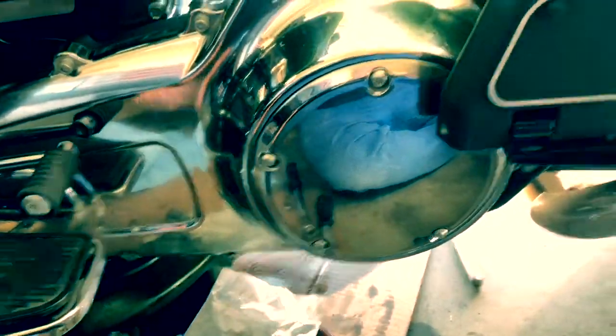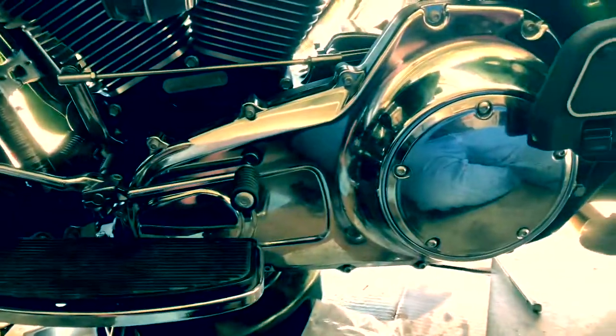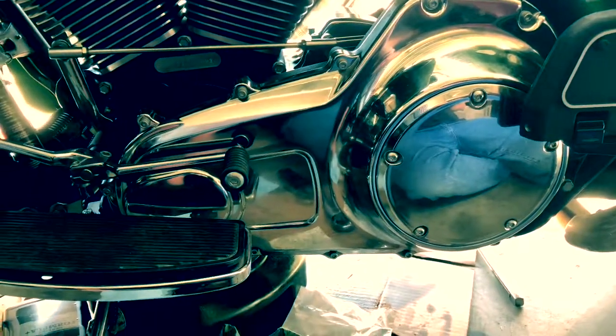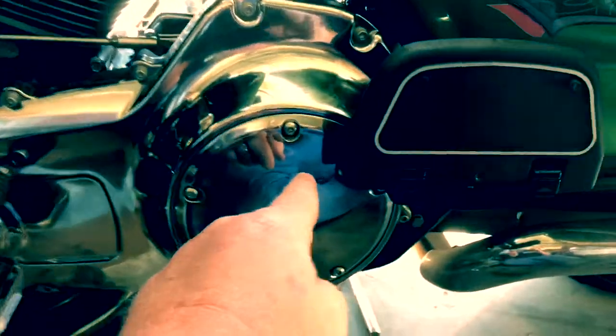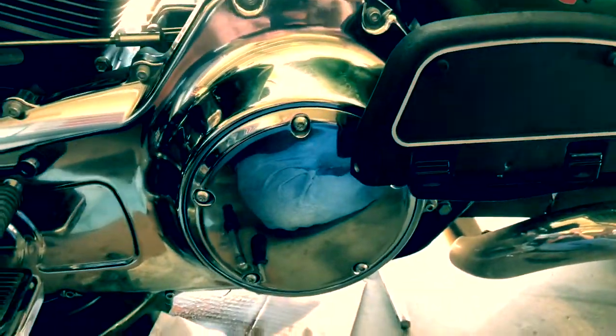The other thing I forgot to mention were underneath here your three drain plugs. Those are, I want to say, like 17 to 21 foot pounds. So I said like 19 foot pounds. So remember, that's foot pounds. Inch pounds on these. You try putting 95 foot pounds on these, you're going to break them. Come on, use your head.